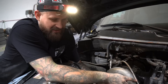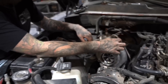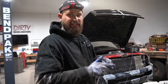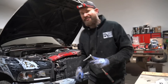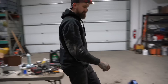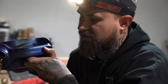We have to put this oil feed line on backwards because it wouldn't clear the new exhaust manifold — it's got a wicked curve. We're going to need a 45-degree angle fitting, but we pre-lubed the turbo, so that mystery is solved for now. Every time you change a turbo you always want to change the oil at the same time. Funny enough, I've owned this truck for about four years and never done an oil change on it. Mechanics just know how long they can push something. But hey, it's a 12-valve Cummins — it's basically indestructible.